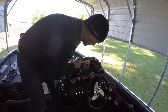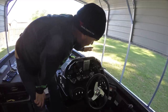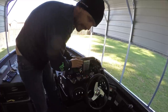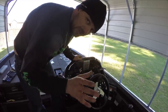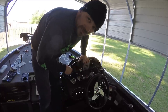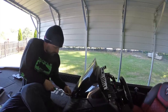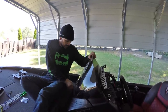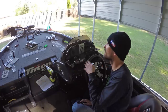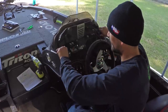I got my screws in — I left it just a hair loose because I'm going to reinstall the windshield and reinstall the shroud. I want a little bit of play so I can adjust the shroud and get it seated back in the slots. I like to do the lower windshield portion first — it makes it a little bit easier because you can dance the rest of them into their slots. We're going to get the graphs on here and get started on the front.